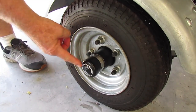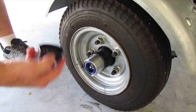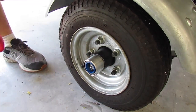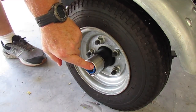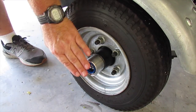The one I have has auto-check with the bra. This is a bearing buddy, and this is the bearing buddy bra. The bra is just a piece of plastic that slips over this to keep any grease that might come out from flinging all over everything. You can see there's a little bit of liquid in there — that's just from sitting in the garage and having any water that's gotten into the system pushed out. This particular bearing buddy has what's called the auto-check — that's this blue thing. When you put a grease gun on here and pump it, this actually starts to protrude and it shows you how full it is. Not all bearing buddies come with this; that's kind of an extra.